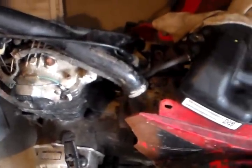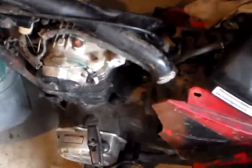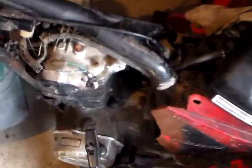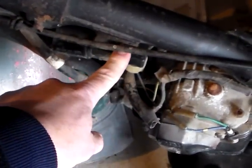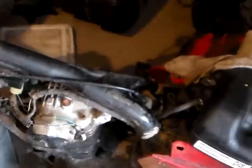A quick comment: if you fire up one of these engines with the advance set too fast, you can do the whole timing thing through this little hole and turn the plate forward and backwards to get your timing proper. If your timing is too far advanced you might get a little more power, but that's when the engine kicks back and threatens to rip your arm off. Running it a little retarded might make it easier to start and won't kick back, but you'll lose top end. You want to put the timing where it's supposed to be.